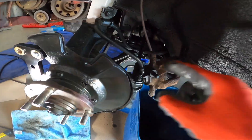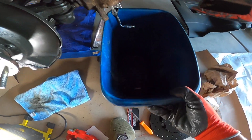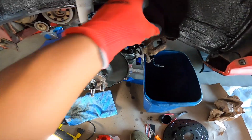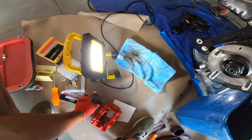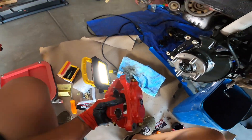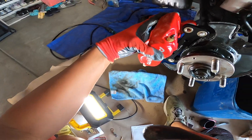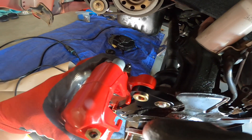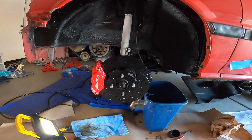We got our new steel brake line in. Still need to pull this out and disconnect that — I will do that in a bit. I have old fluid draining because we are upgrading the fluid with these new brakes. I'm gonna remove the old caliper and then get the hardware ready for our new caliper to go in — it fits in something like so, with a bolt coming in from the back and a washer in between.